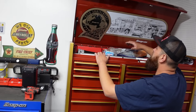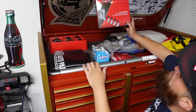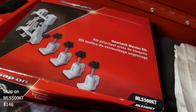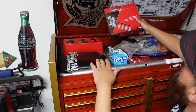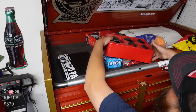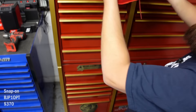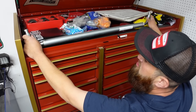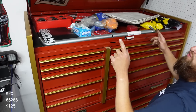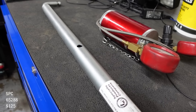Up here I've just got some junk — fender cover. I bought these from Snap-on thinking I'd use them more for timing belts or holding sprockets in position, but I don't think it's ever really worked. I got a Snap-on ball joint press and some different adapters for various applications. This one is for the Chevy Trailblazer platform — when you do alignments you have to move the lower control arms for camber and caster, and you need this special tool to push them in and out.